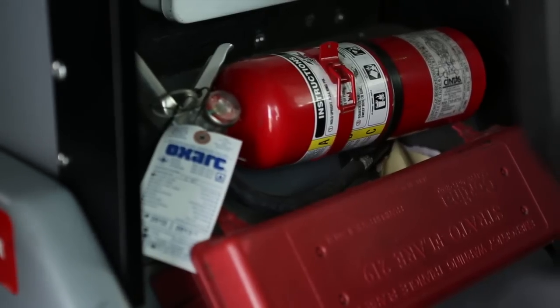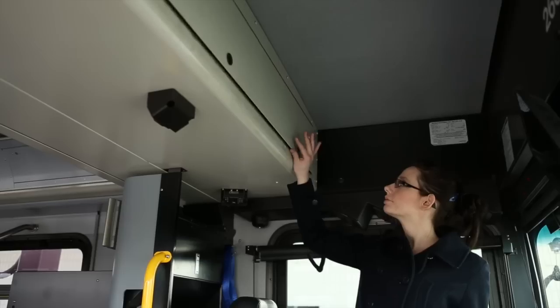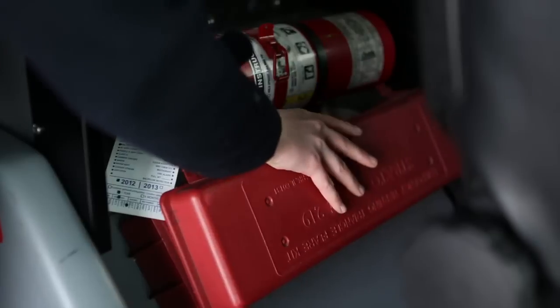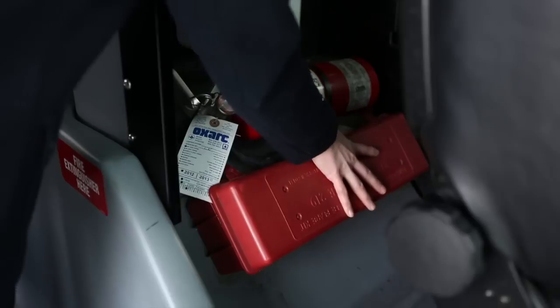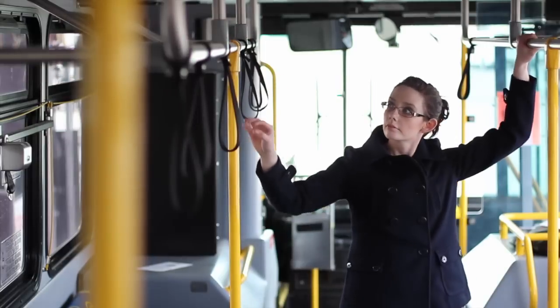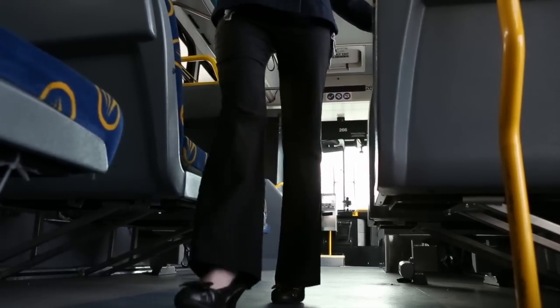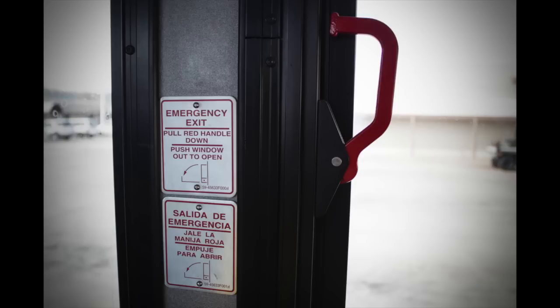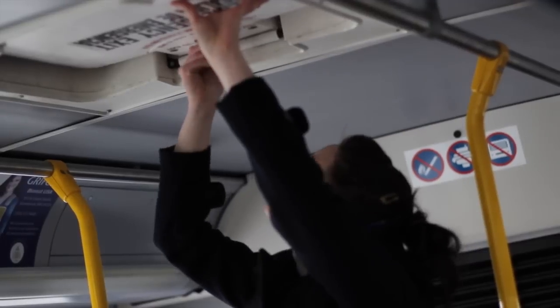Check the emergency safety equipment to be sure it is present. There should be a fire extinguisher that is properly rated and secure. Identify where the circuit breakers or fuses are located. There should be three reflective triangles. Check the passenger seating — seat frames should not be broken and must be firmly attached to the floor, and seat cushions should be securely attached to the seat frames. Check all emergency exits: identify where all of them are, be sure hinges are secured and seals are intact. Demonstrate one emergency exit other than the primary entrance — it should operate smoothly, close securely, and not be damaged.